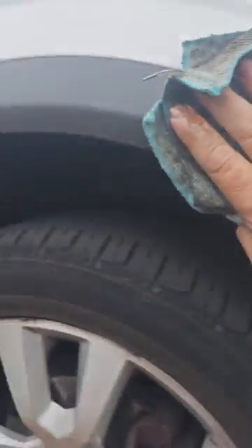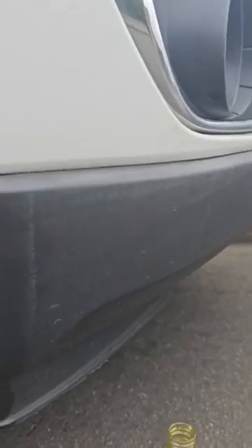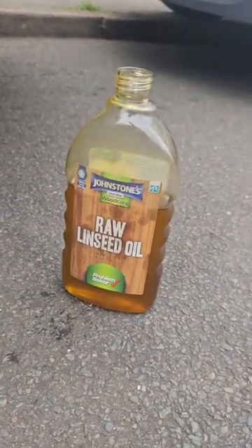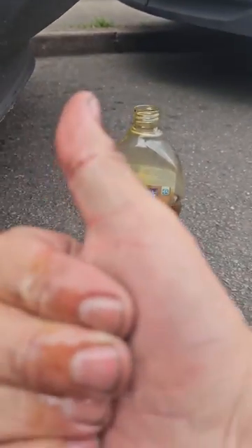We'll do a split look. Get your cloth, just wipe off your excess. And it is that simple to go back to black on your bumpers — there we go. Just got the rest of the car to do now. Linseed oil, dirty sponge, dirty rag — sorted.